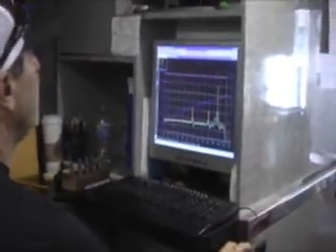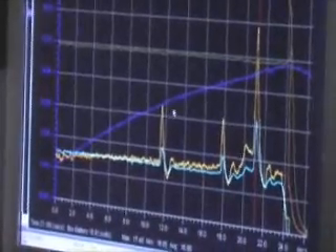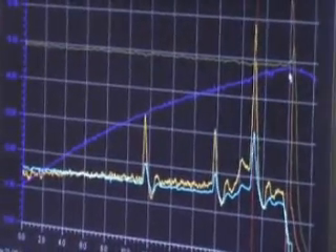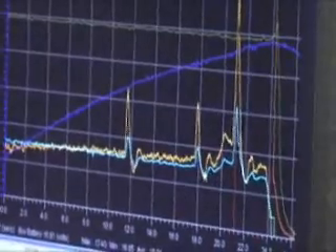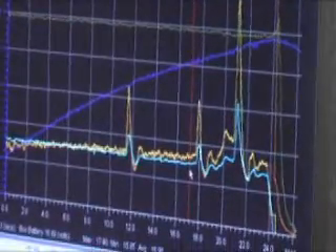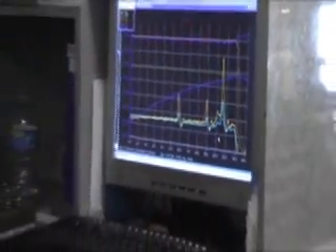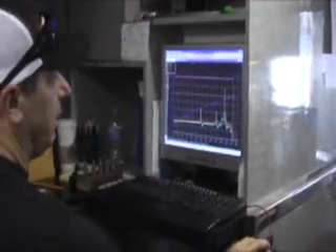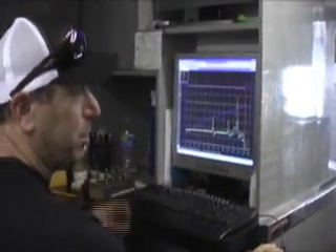Also look at all the pressures. This line here is vacuum — you can see it steadily goes up, this blue line right here. It's building vacuum in the crankcase, up to about 17 inches right there just on that little warm-up. I always look at oil pressure — right now we have about 15 pounds of oil pressure. As the motor gets hotter it gets less oil pressure, and as the vacuum gets higher it also gets less oil pressure because it's a differential between the two.